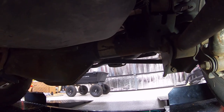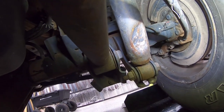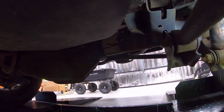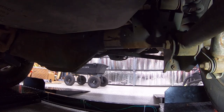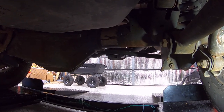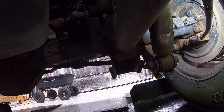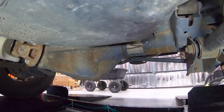Tallying things up: we knew we'd need rims and tires, and seeing that really bent rim confirms it. We're potentially going to need rear shocks, new brake cables, a rear sway bar, sway bar end links, and sway bar bushings at minimum. That's on top of normal preventative maintenance like we did on our 09 — replacing all the brakes, rotors, and so on.